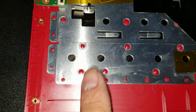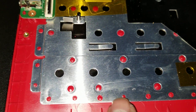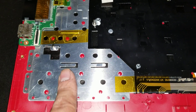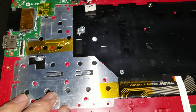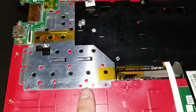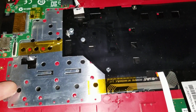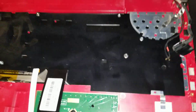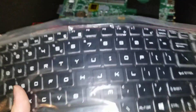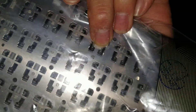To remove the keyboard, if you have a bare keyboard it's very difficult — you actually have to break all these red plastic things out and peel all this black plastic out to get it out. To put in a new keyboard, you're going to have to melt new plastic or some kind of glue. The keyboard might be sunk underneath the frame so it won't be popping out as much — I have to cut up pieces of cardboard to put underneath the keys. If you're planning on replacing the keyboard yourself, try and buy this whole plastic piece because otherwise it's a lot of work and things probably won't go back together properly.